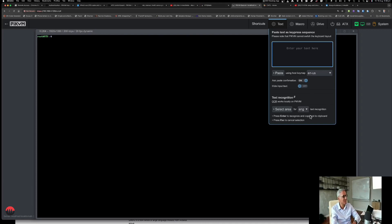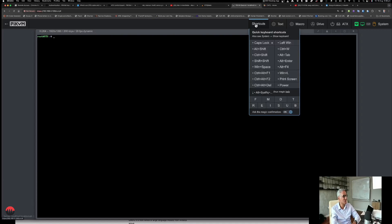You can also send text directly to the remote system — note the KVM can't switch keyboard layouts so bear that in mind. Keyboard shortcuts are configurable too. For me the main value is being able to see what's happening when I reboot the server, and critically, being able to access the BIOS remotely — something you can't do with just a software reset — which is very useful if you need to configure BIOS or watch the OS come up cleanly after a cold reset.